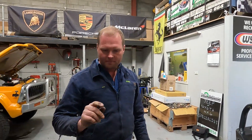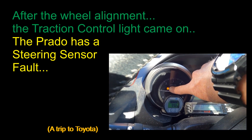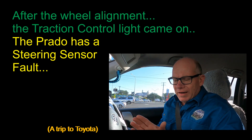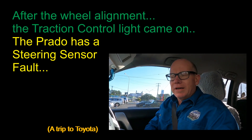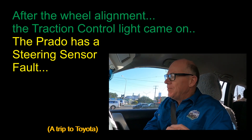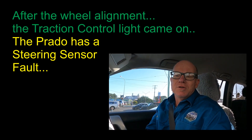So we'll just put it back up now and put the bash plates back on - and then we're good to go. Done! Well done. You guys see that little light there? If you have that stay on at any time - can you believe it - these Prados have a steering sensor. What Adam was explaining to me was that when they've done the wheel alignment, because of the suspension upgrade and everything that's happened, it's gone out of the parameters for what this car is set for, or what the computer knows it to be set for. So what they've got to do is zero it back to where it should be and calibrate the computer or the sensor. Anyway, there's something for you guys at home: if you ever have that little light come on and it just stays on, that's what it is - it's your steering sensor.